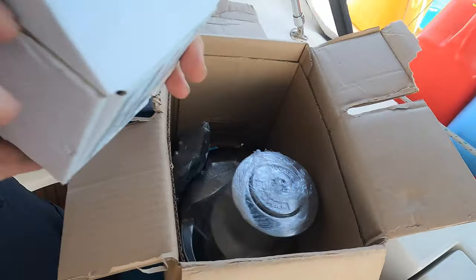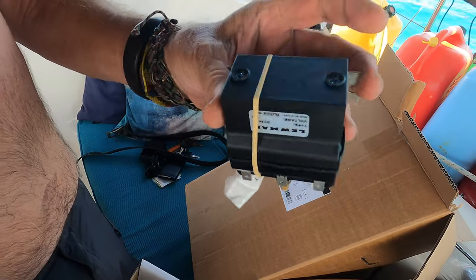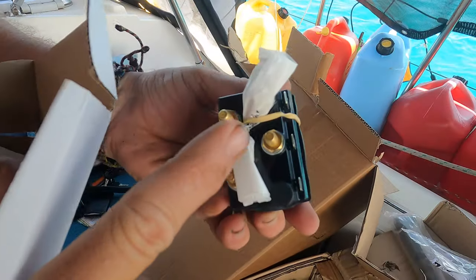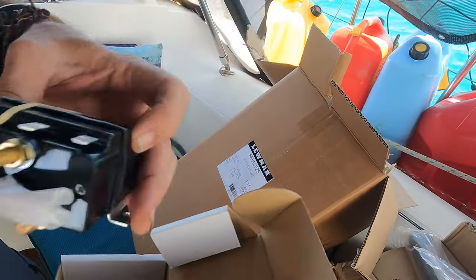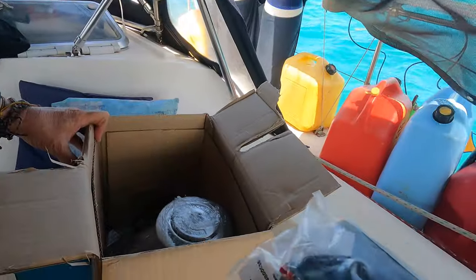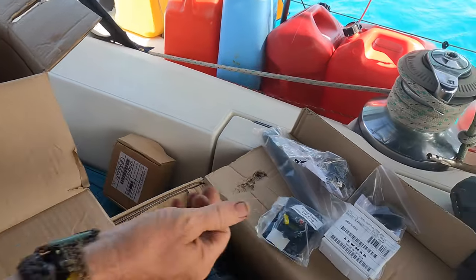This is part of our assembly because this is the conversion to 24 volts. This is a dual system - a dual relay, high amperage for up and down. This is probably going to be the input and then up or down output to the motor itself. We have to install that to replace the solenoids that are there now which are all 12 volt. It's got a 120 amp or 110 amp 24 volt circuit breaker.